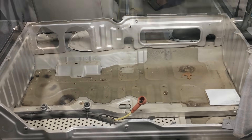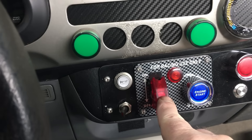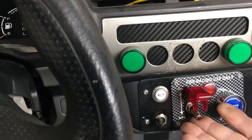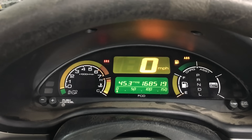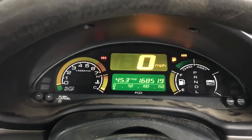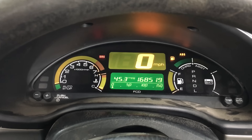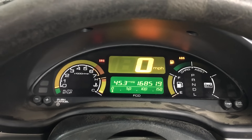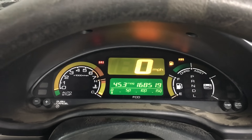Let's take a look at the new switch panel. This is the main power switch, and when I flip it — that's an original type instrument panel for this car. The good news is the speedometer, the tachometer, and a few other things can be made to work again. The speedo and the tach are not driven by the CAN bus; instead, they use external signals that are easy to replicate with something like an Arduino. That's a project for another day.